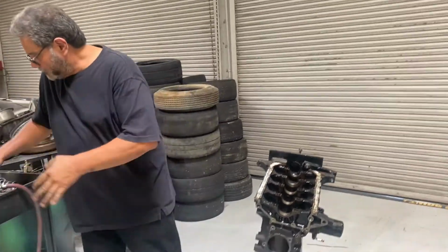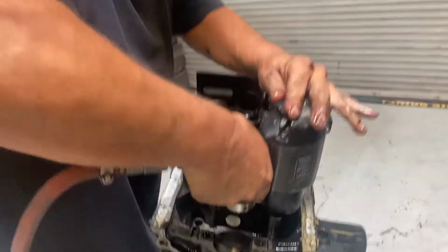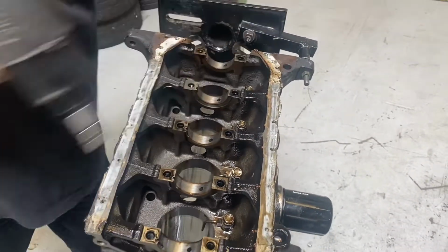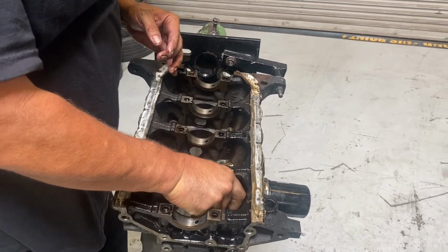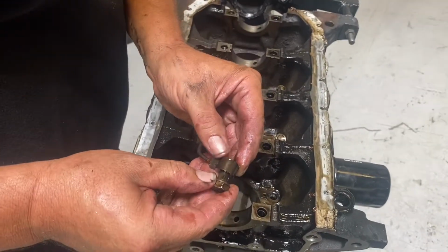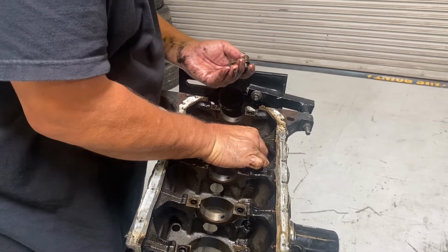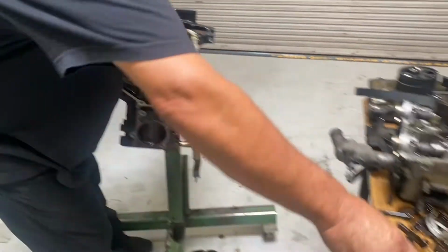All right, so what I have left now on my little squirter tube, I'm going to go ahead and just buzz those off. Okay. And basically these help lubricate oil on the piston. You'll see that you have a copper washer usually in here. So I'm taking, these don't have to be numbered. Okay, and I'll set those aside.